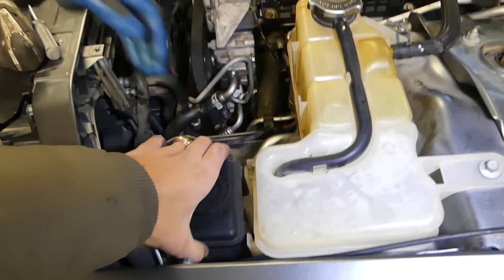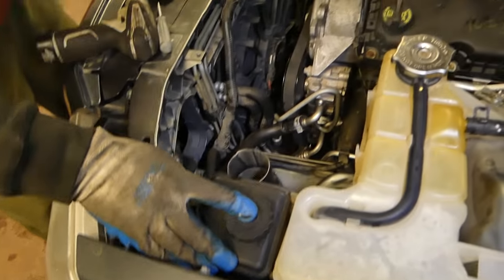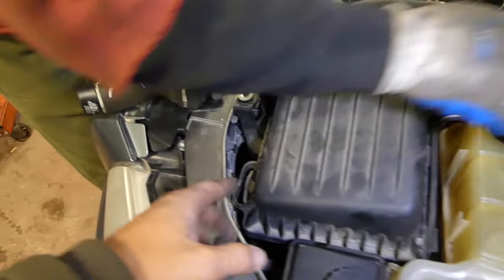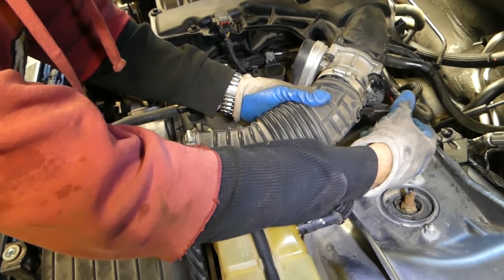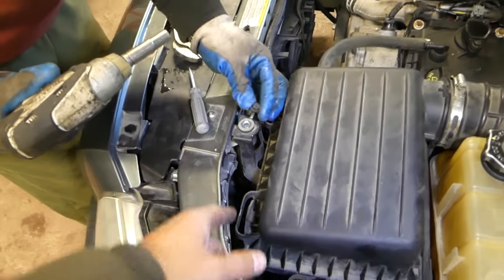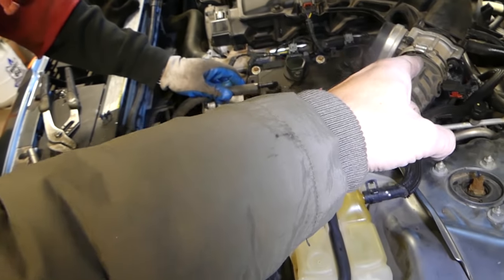Get this one into the grooves and push it down until it clicks. Next, install the airbox — it just goes into the hole. Connect the mass airflow sensor on it and install the 10 millimeter bolt. Get the clamp tightened and that's the whole procedure. Make sure you watch our video on how to bleed the system, because if you don't you'll screw the engine up. Thank you for watching and see you next time.